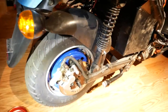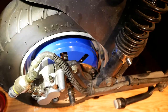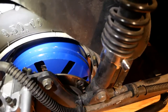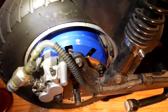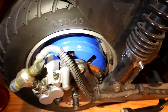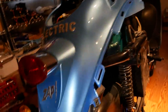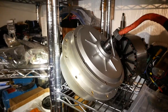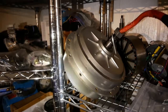What I want to talk about here is the things I've done to it. Since I had the other Zapp I kept the motor off it — that's this motor right here. I took it all apart, vented the covers so that air could get in. I also replaced the halls, and since the silver paint on it was pretty crusty looking I repainted it blue, which sort of matches the teal blue of the paint job on the scooter. The original motor that was on it is right there — it got pretty hot on a previous test run and cooked the halls. Motor is fine, phases are fine; I just need to replace the halls in it. It's still got the factory temp switch in it, which I'll talk about too.